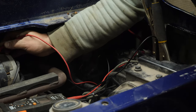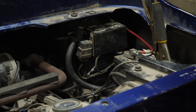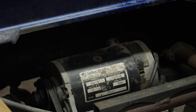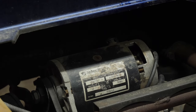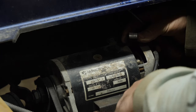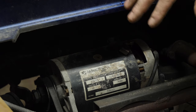We're going to take a look at the brushes and see what they look like. Usually by looking at one brush you can tell almost immediately the condition of the brushes. They look like they're a little funky - we are having some bad luck here with our starter generator. Yeah, those brushes are worn out. So it looks like we have multiple issues with this cart - I'm going to have to get in touch with the customer and let them know we need brushes for the starter generator, and he needs a battery. He's got a new solenoid now, so that's okay.